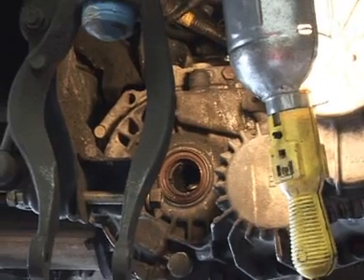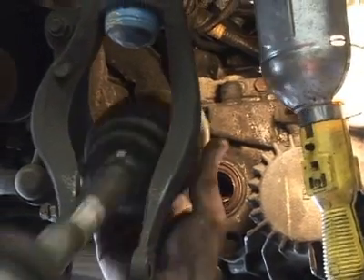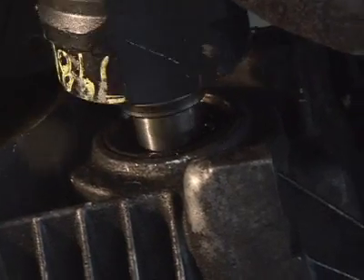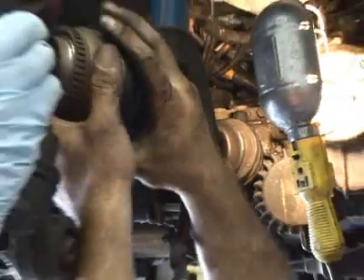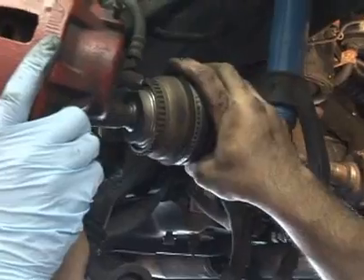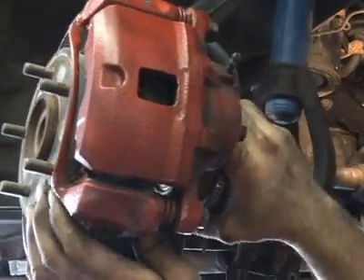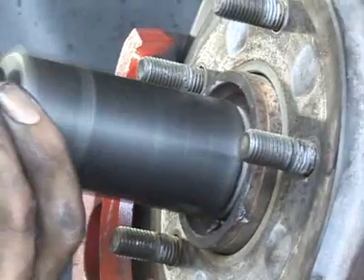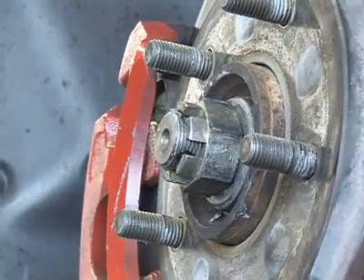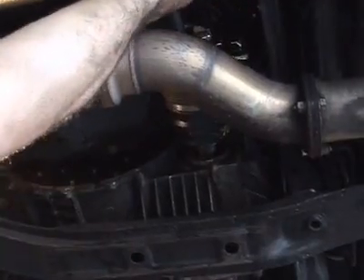You take the drive shaft through the suspension. One end goes into the differential, like so. The other end will go into the knuckle. Both sides are splined. Once this is bolted up, you're directly connected to the transmission, and then you can reassemble the rest of your suspension.